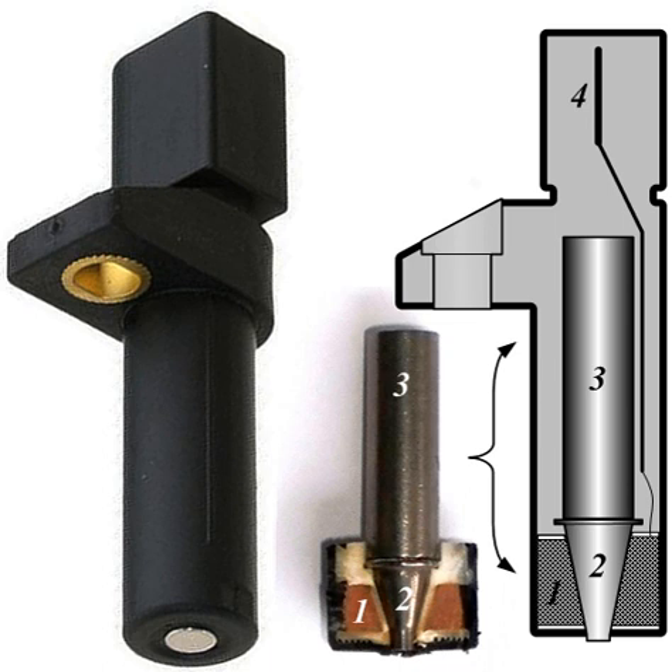When it goes wrong, it stops transmitting the signal which contains the vital data for the ignition and other parts in the system. A bad crank position sensor can worsen the way the engine idles or the acceleration behavior. If the engine is revved up with a bad or faulty sensor, it may cause misfiring, motor vibration, or backfires.